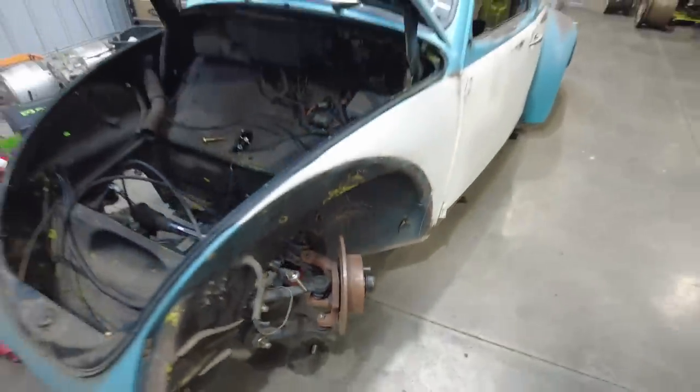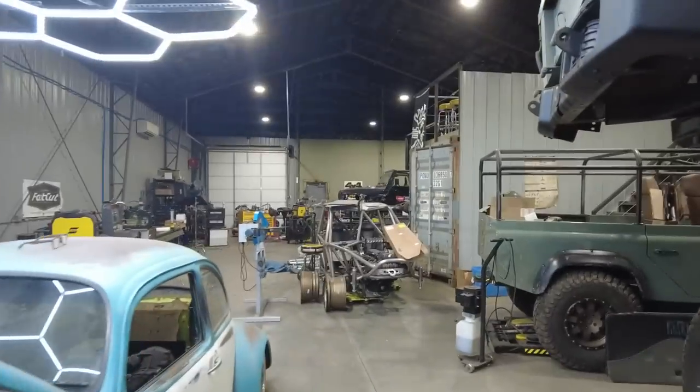It makes setting up the steering actually pretty simple because I don't have to worry about bump steer, even though I'm using that rack. Normally when you put a steering rack in, you have to make sure the pivot points are the exact same spot that the A-arms pivot at, but I don't need to worry about that because I don't have A-arms. I got these little trailing arms on here. So anyway, that's the plan. Prep it, get all the kind of junk done, and get all the work done on here so when the crew comes in, they can basically, ba-da, front suspension.